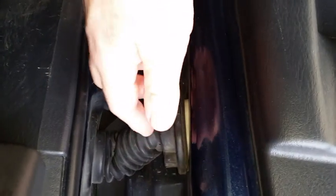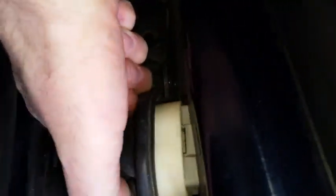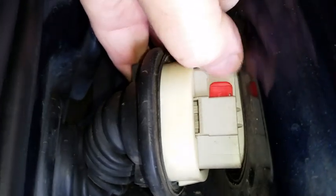Okay, first thing is the actual connector to the door, which again, from here to that way is one set of one connector and wires, and then the door has a connector that goes inside. If you notice closely, there's a tab up here. You basically grab it on the top and bottom, and it makes this plastic holder pop out. A lot of Chryslers have this, I don't know about other brands of cars, but you pull this red tab down. Either pull like I did with my thumbnail, or you can push the other end out, but you've got to get that down, otherwise the connector will not be able to be released.